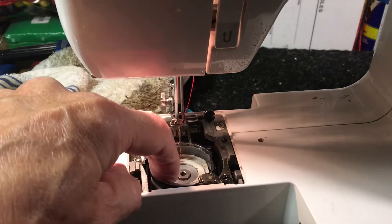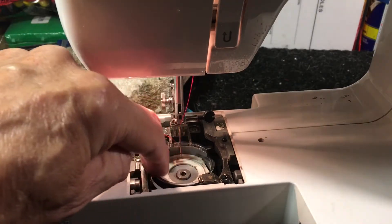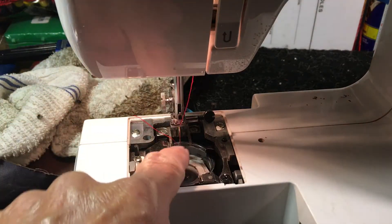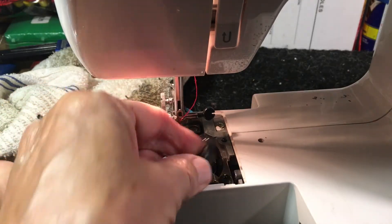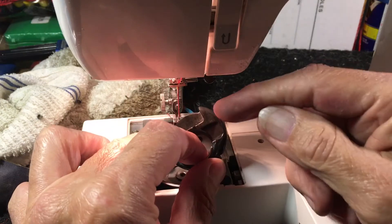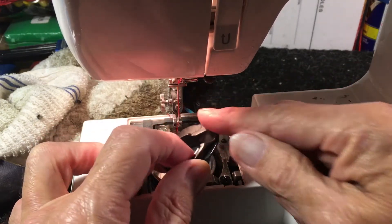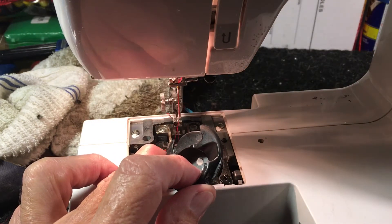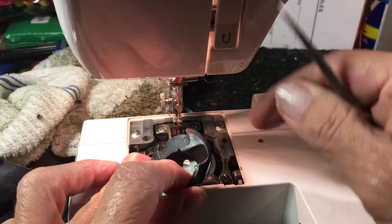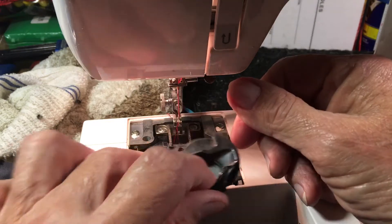You've got to get that as smooth as it can be. That's why everything's plated — it's got to be smooth. There can't be a snag. When you run your finger across there, you cannot feel a snag. It'll snag the thread, it'll flip this up, the needle will come down, this will flip out, the needle will hit it. This one had a bunch of impacts along here, which we filed and smoothed off. You file them if they're sticking up — you can have an indentation or a depression, that's okay, but if anything's sticking up, the thread will snag on it.